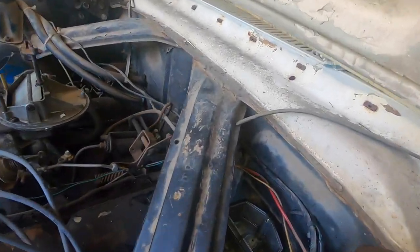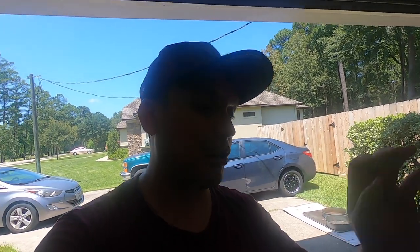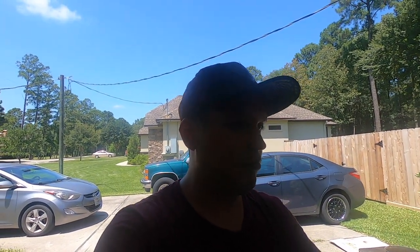So far we have done the passenger rear. Check out the little reservoir in the back - it took a lot of fluid. While you're doing this you want to maintain the fluid in that reservoir so it doesn't start sucking air from the master cylinder. I'm going to fill that back up, do the driver's side rear, and then go around twice on the vehicle just to be sure. The flow is solid coming out of the passenger rear and I want it like that on every side - I want to be double and triple sure we're not going to have any brake issues.